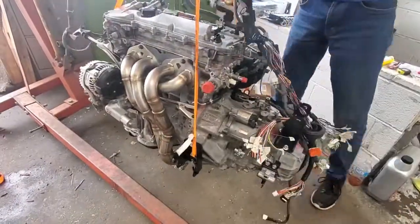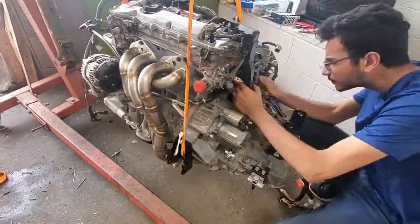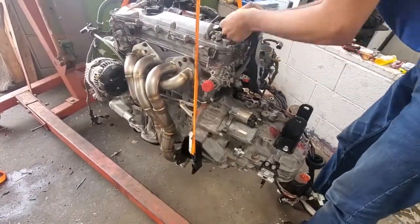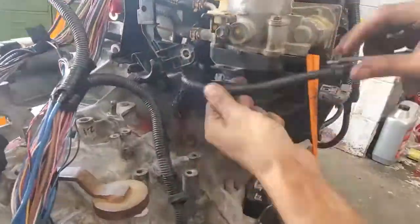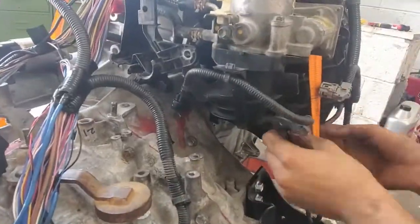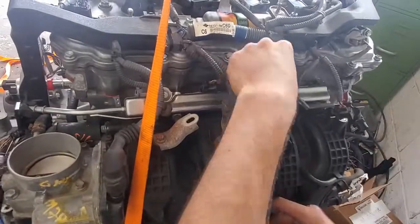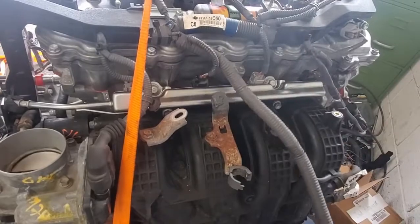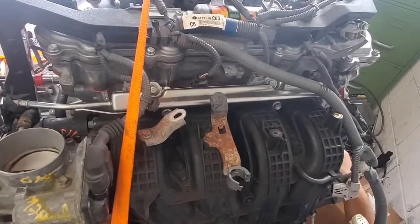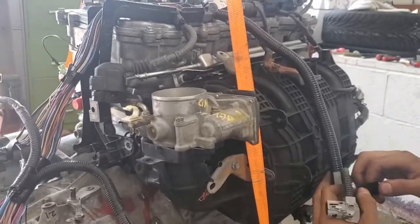Next is the harness. It is totally unnecessary to do this, but I removed the tumble valve, O2 sensor, and automatic transmission wires from their plugs and pulled the wires through the entire harness — just to reduce clutter and make it easier to find the wires I needed. These amounted to about 40 wires, so it was worth the cleanup for me. I'll show what I did to modify the harness in the next video. The reason I have so many wires sticking out is because this swap currently needs an aftermarket ECU and I need to rewire the ECU wires, which I plan to do after the engine is in the chassis.